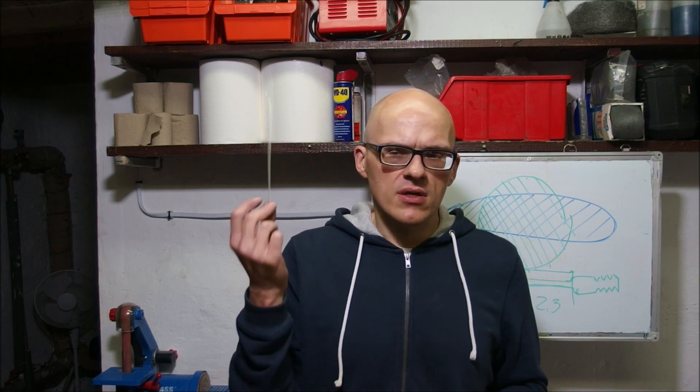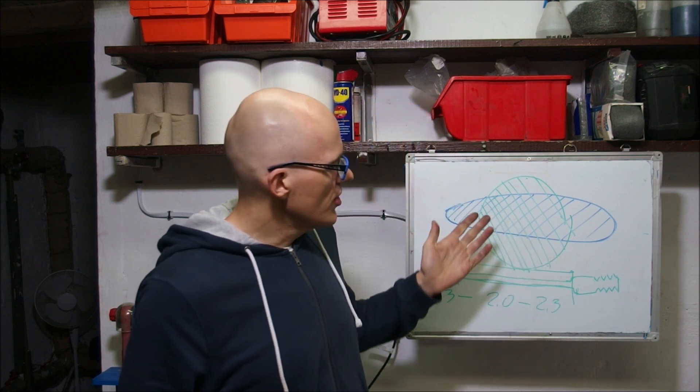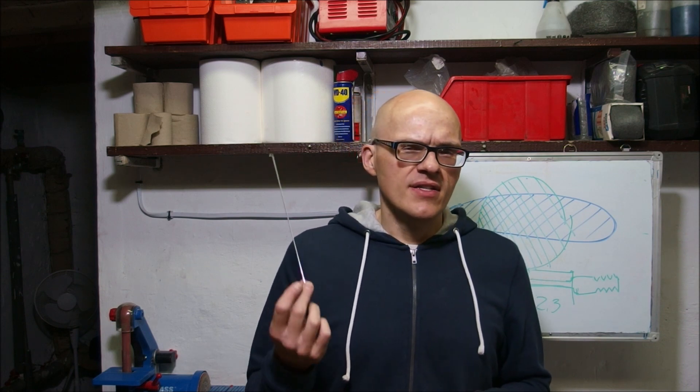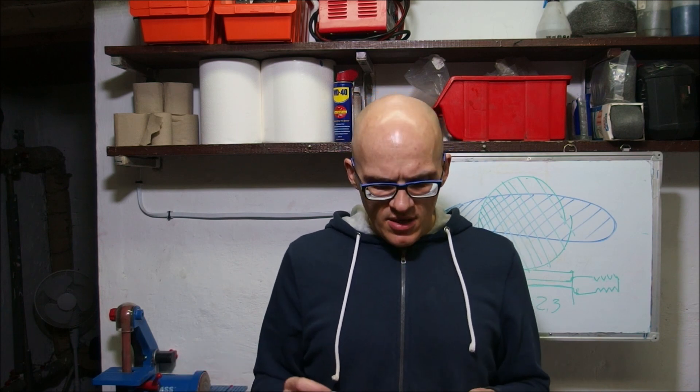Alright, so this is essentially all you need to know about spokes. In summary: a spoke needs to be stainless steel, rolled thread, J-Bend, in a properly tensioned wheel — and you're done. If you are chasing grams or want to do special things, you might want to consider butted spokes. If you are chasing aerodynamics, consider aerodynamic spokes. If you are chasing looks, then straight pull is probably something you want to consider. You don't necessarily need to be afraid of carbon fiber or aluminum spokes, because as long as a material doesn't elongate too much during being preloaded, it's going to work like a spoke perfectly. Theoretically, if you manage to make a string which can be preloaded, you can make a spoke out of it — and I think some company actually does that.